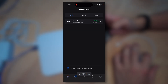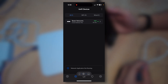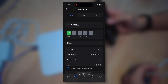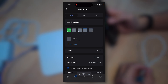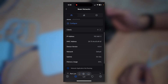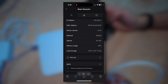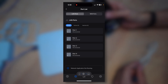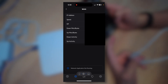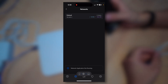I'm going to click on the device icon — it's the second one in the bottom left. If you click on the Cloud Gateway, you'll see a bunch of info about it. The ports show up here — all five different ethernet ports — and you can actually click 'Configure' for any of them and switch the network they are assigned to. If you scroll down, you'll see the IP address of your UCG, MAC address, device version, network, uptime, memory usage, and load average, just like you'd see on Linux. If you click on port list, you'll see your WAN ports and LAN ports. And under WAN or networks, you'll see more information about your WAN connection, live activity, and your usage on each individual network.